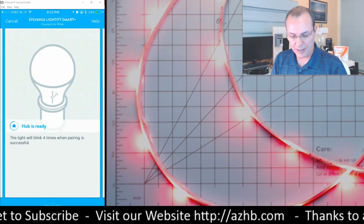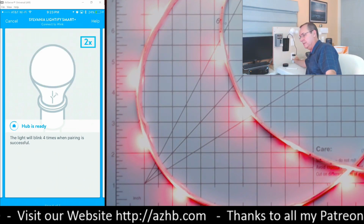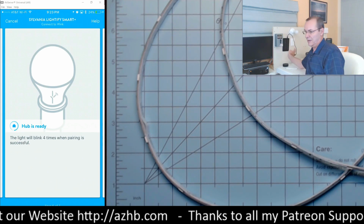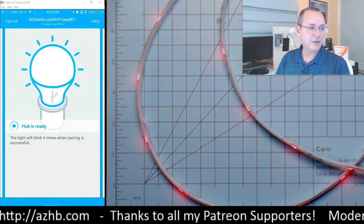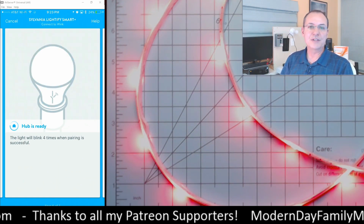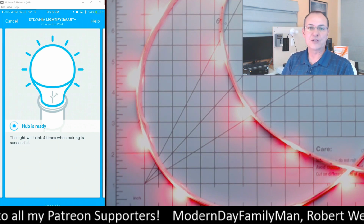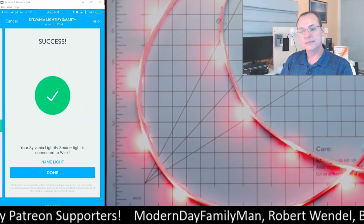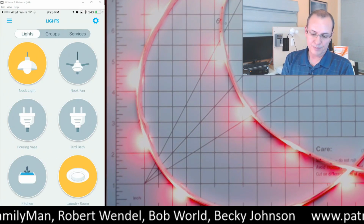All right, and then we're going to need to power it off and power it back on. And we get that flash there. That 3, then 4 sets of flashes there means that this has synced into the Wink Hub. And then it takes just a couple of seconds for it to come up in the app. There we go. Done. We'll scroll to the bottom.